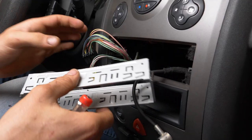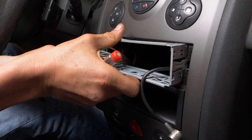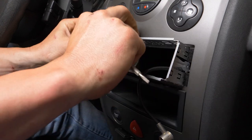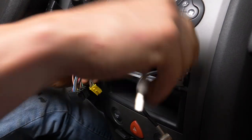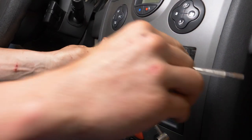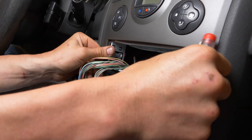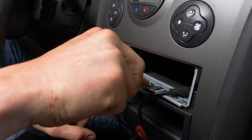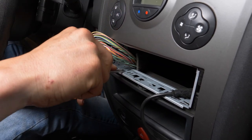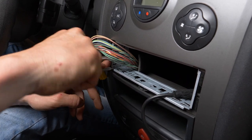Put the rack provided in place with the new radio, slipping wires inside beforehand. Once the rack has been properly placed into its compartment, lock it in place with a flathead screwdriver by pushing down all the metal tabs. Make sure to fold each tab so that the rack is perfectly fixed in place.